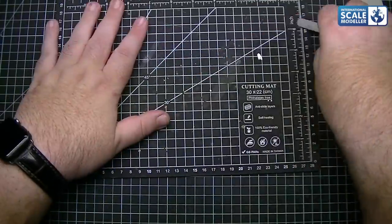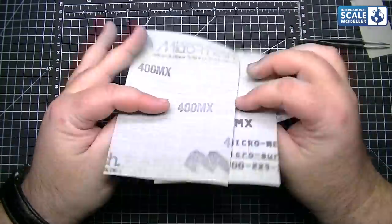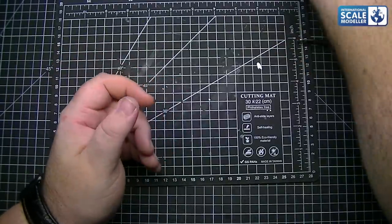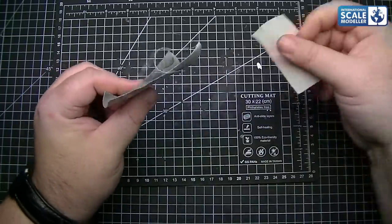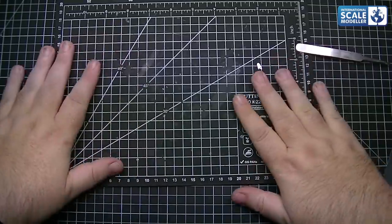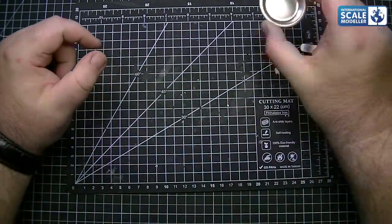So happy with that. So what we're going to do, we're going to use some micro mesh. So this is ever so slightly cotton-backed wet and dry paper. You can get this on eBay. If I can find a link, I'll pop it in the description for you. And we're going to use 8,000 and 12,000 grade. It's marked as 800 and 1200 on the sheet. Use it wet. Always use it wet. That is the idea of it.